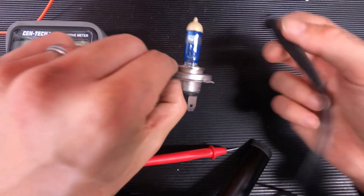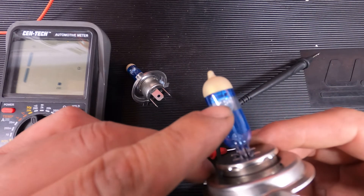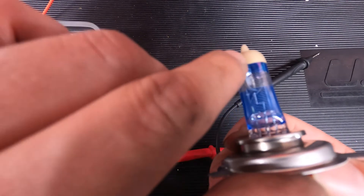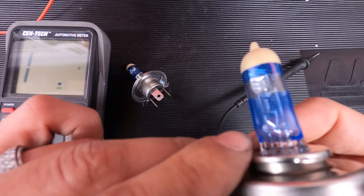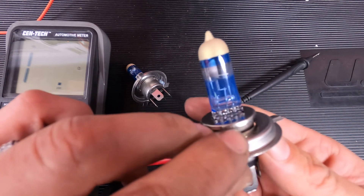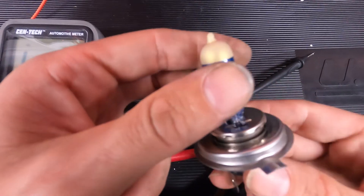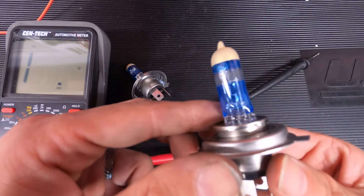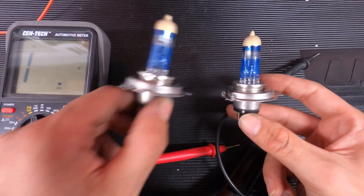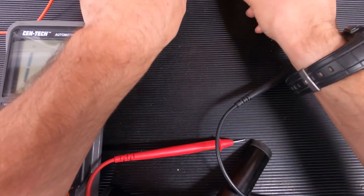Can I visually spot that? Nope, I can't. But I know that our low beam bulb is up here, and so likely the piece that wraps up over the back is probably burned out. Typically you're going to see the coil itself burned out, but it's a little harder to see in this one. So we know this bulb is bad — that's why I just touched the glass; it's okay for me to touch this as a bad bulb. So we're going to go ahead and replace the bulbs on both sides, because if you're replacing one, that means the other one is probably not too far out from going out. You want to replace them with two good known bulbs.